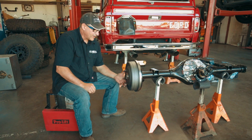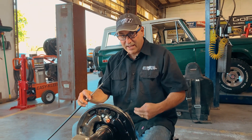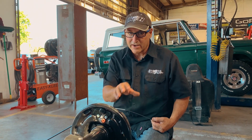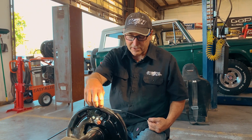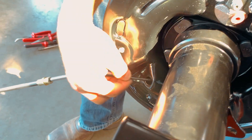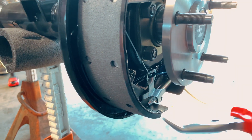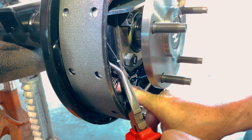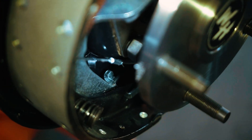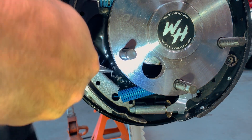Set the drum up there nice and neat, then do the same thing on the other side. I jumped ahead — it's actually easier to put the e-brake cable in before the axle, just because you've got more room to get your fingers in there. It can still be done with the axles in: just use a couple of nuts to bolt the backing plate on, then manipulate the e-brake cable into place. Come in and carefully push the cable up into the area it's going to go, use some pliers and a screwdriver, and there we go — the cable is in place in the slot. Secure it in the housing.